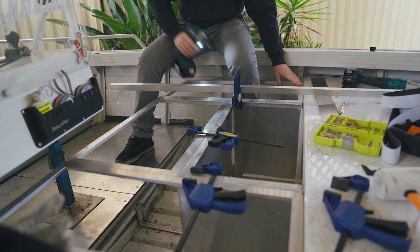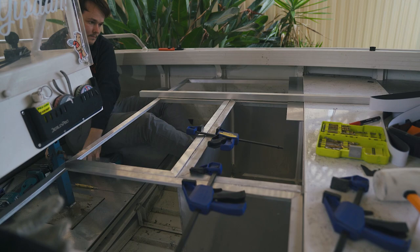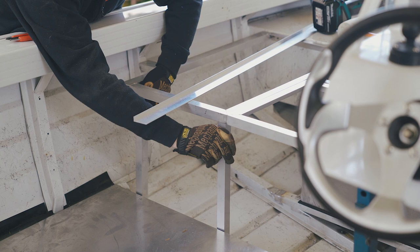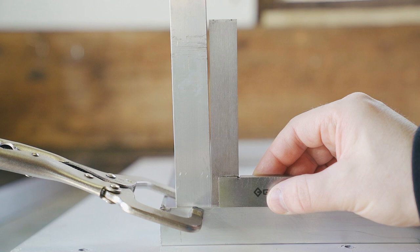Give me your thoughts in the comments if you'd rather I cut out my stuff-ups and show you just the glossy good bits. While I was still piecing together the frame modules, I was using self-tapping screws to hold the pieces in position — not only are they easier to install, but the holes required are much smaller and adjustments could be made relatively easily. I used small off-cut sections of sheet metal to level all the components so the top surface was flush with the bench seat panel. With the perimeter of the frame secured, the upright supports could be measured and welded in, with each hatch module having two vertical supports on the outer corners, mounting directly to the floor trusses using 25mm angle extrusion.